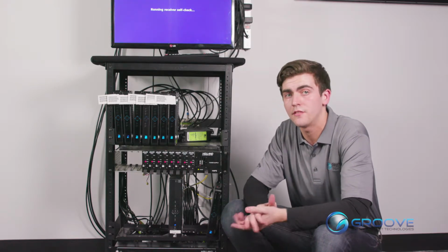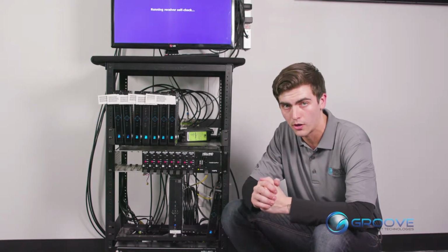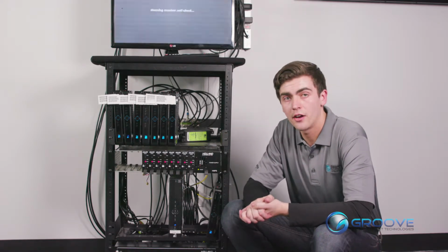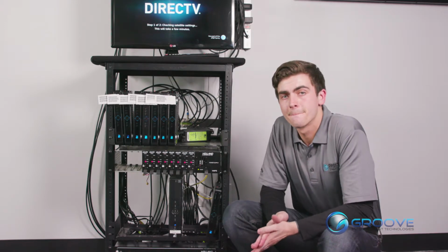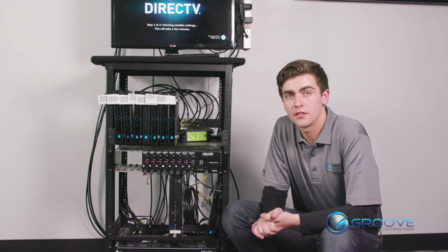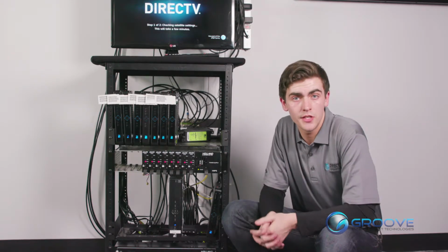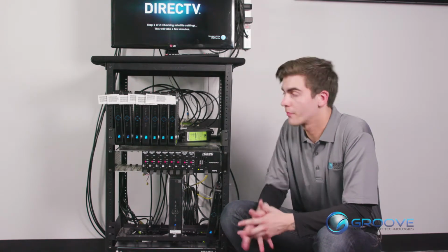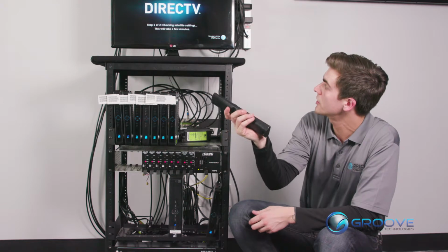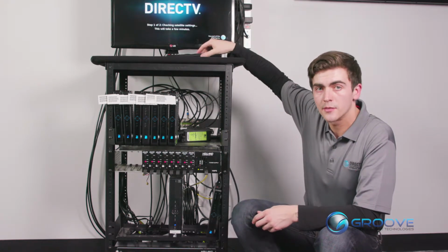If you do not have a TV already in the room, plug the new TV into the coax test port on the rack. It will either be from a rack amplifier or a rack combiner, which I have here. Now turn your test TV on to the channel number of the receiver you're replacing. It might be 2, maybe 15 or 30. In my case, it's 32. You can check that by changing our channel here to number 32 as our receiver starts up.